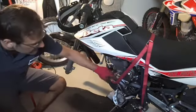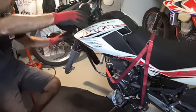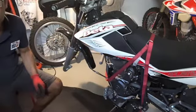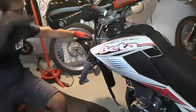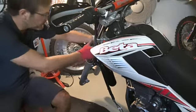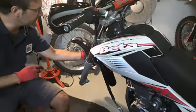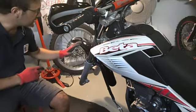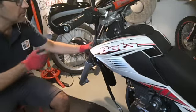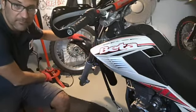With this belt, we secure the caliper to the main part of the bike, so we have the way free here. In this moment, we could release and unmount the assembly of the 2 forks in one piece, but it would be a mistake because there is no brace here, no rigid connection, only the mud guard, which is flexible, it's plastic. So if we would do that, the mud guard would break here.